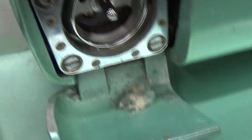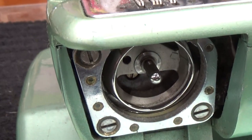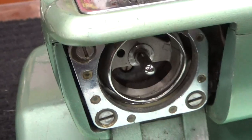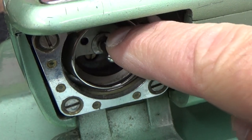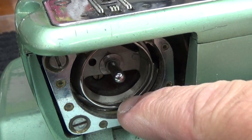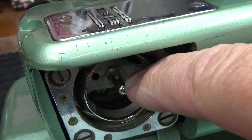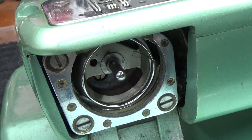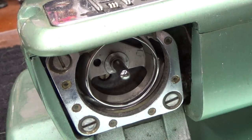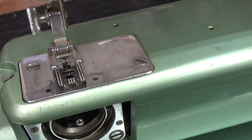That's okay. They wanted to have a raceway area that would be virtually jam-proof so that you could use heavier threads. You could do a number of different things in the sewing process. And because it has its floating capacity, left and right, up and down, it would be less inclined to jam. So if you have one of these, or if you've acquired one of these and you're going, oh, geez, something must be broken, it's designed to do that. It's called a jam-free raceway, and the Swedish were very proud of it when they developed the technology. And others since have tried to copy it to not as much success as the Swedish did. They just didn't. So kudos to the Swedish. They are super smart folks. They just are.